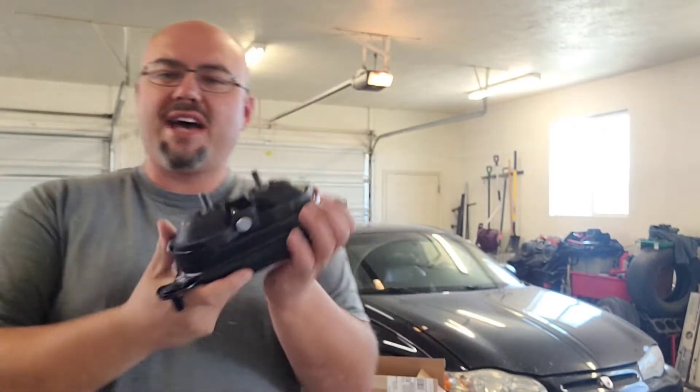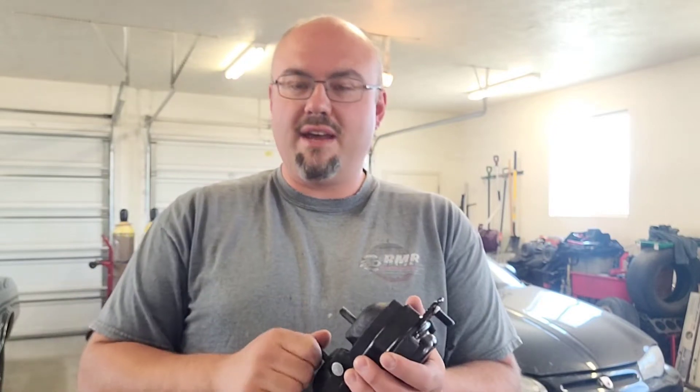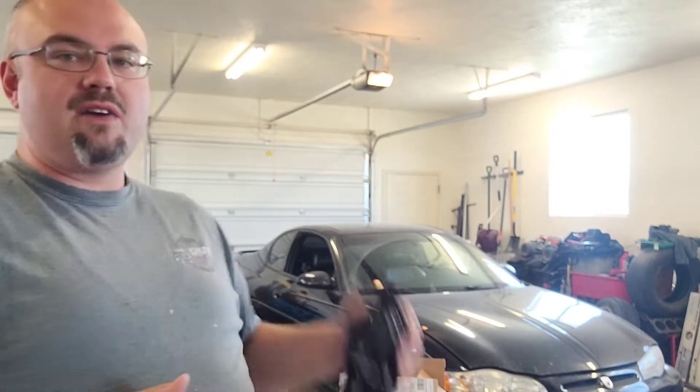This one needs the passenger side lower motor mount — this ugly guy right here. I've done a little bit of reading about how to do it. Basically, wheel comes off, shroud comes off, the four bolts come loose, you crank the engine up to the moon, and everything is supposed to come out. Be aware that there are some power steering lines down there — don't hurt those. I got this motor mount at my local AutoZone. I'll drop a link in the description so you guys know what part number we're working on. Let me grab some tools, grab my skill light, and let's get this process going. This shouldn't be too hard.